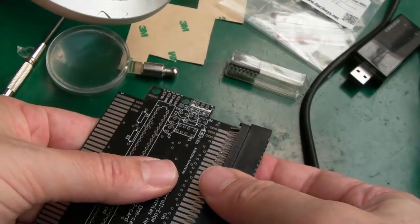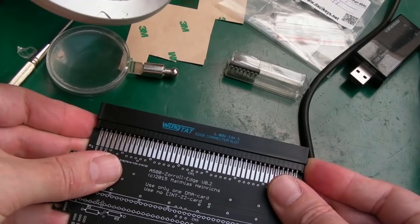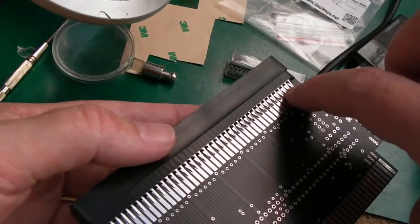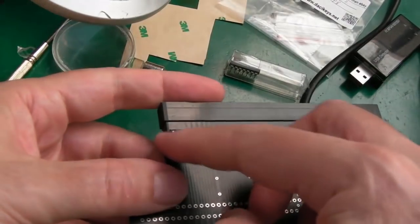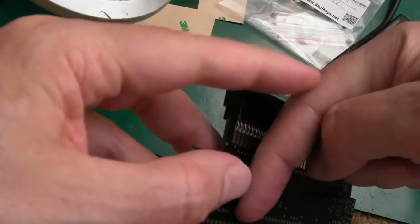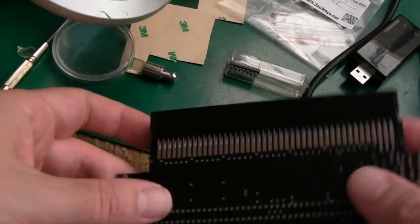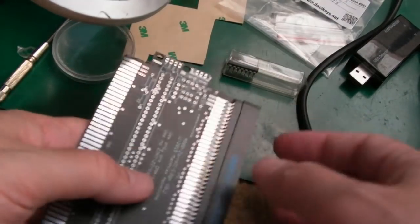There we go. And if we just put it into position, there we go. Hold it. So you can see they're all really taut there. They're all flat at the point of the tip. Now this is where you do need to make sure you've got lots of solder though, because if you don't get lots of solder down the length of this and all under the angle, the part where it's lifted off the PCB, under this part here, any pressure, you could damage your connection. So I'll just hold that there like that, and it does go this way around, by the way.